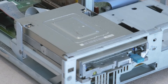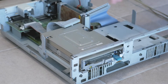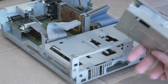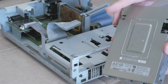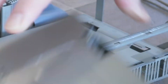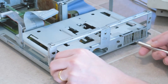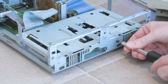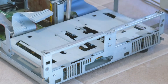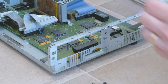The PS1's floppy drive is a design introduced with the PS2. It's very similar to the standard PC floppy drive of the 90s, but do not plug the PS1's 34-pin header connector into such a drive — it incompatibly integrates 5V and 12V intended to power the drive and uses another pin for drive type sensing. Now that we've removed the drives, there are three screws to undo before we can remove the tray. All have a hex head with a flat head screwdriver slot for convenience. With that removed, we can easily take out the tray and see the goodies underneath.